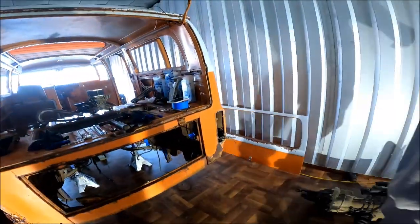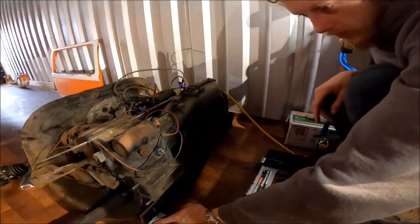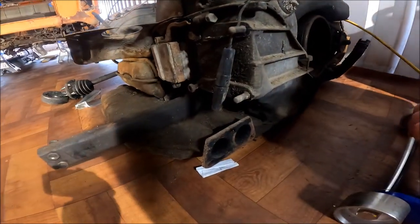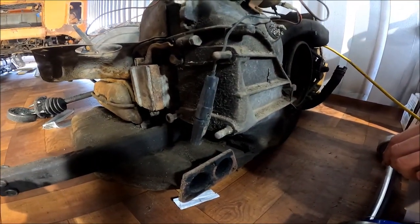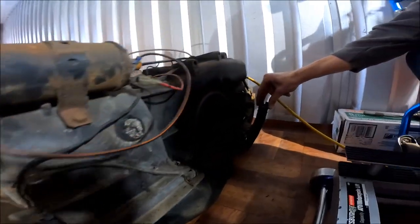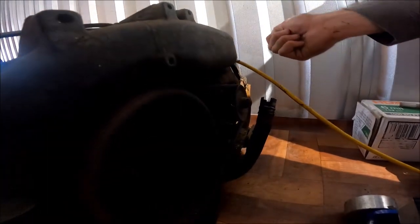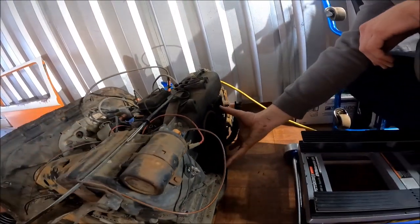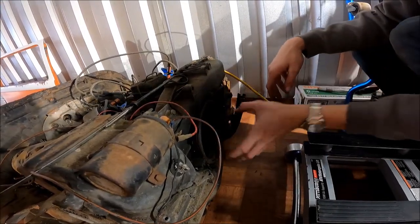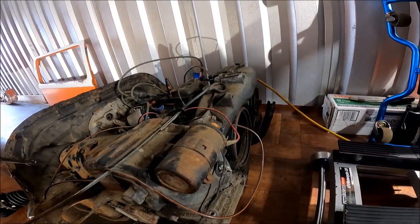After that, we went ahead and started on the engine, pulling the exhaust first with these 3 bolts on either side and pull it right off. Thankfully, those were nice and easy to break loose, nothing busted. After that, pulled the oil filler extension off and we pulled the dipstick out to make a little bit of front clearance. We pulled this cover right here. There's a plastic round cover that came off. That one was nice and easy, gained a little bit of clearance.